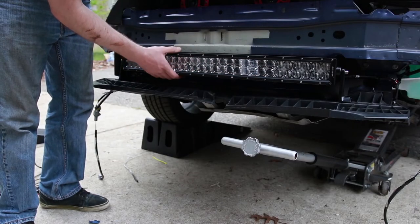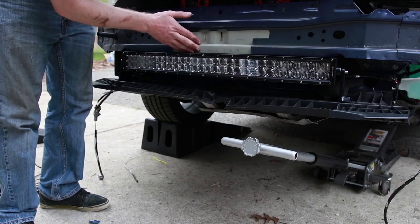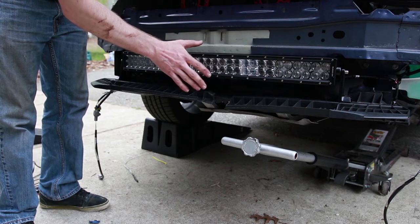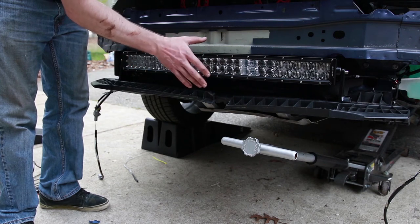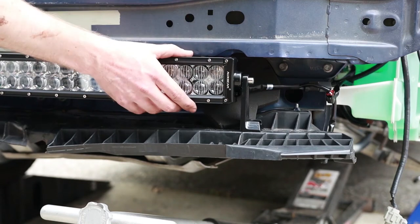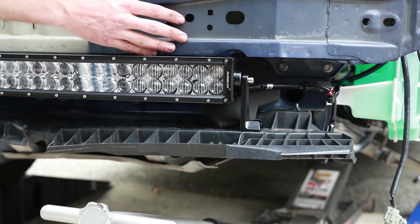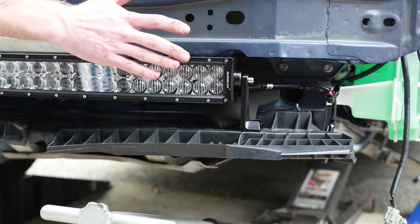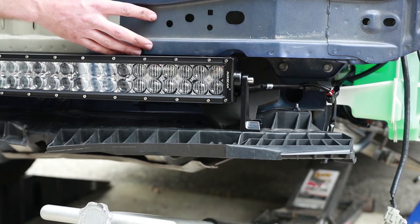So this is where we're mounting the light bar. The brackets are just the right height to mount it right below the crash bar. With the aftermarket grill, my brother will still be able to have a lower grill — a lot of people run this without reinstalling the lower grill, but with his aftermarket setup, he'll be able to keep it. The very edge of the light rubs just a little bit on the crash bar, and as it vibrates it will eventually wear the paint down, so we're going to take a grinder and grind off this little corner. There's no structural integrity to this piece — it's just a slight overlap between matching pieces of metal on the car.